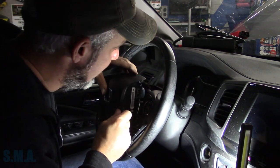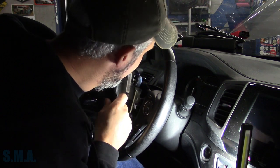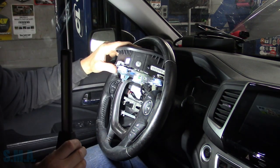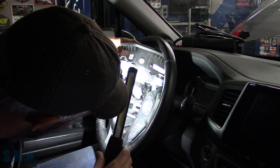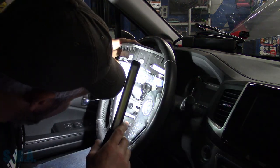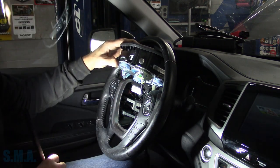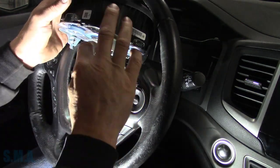It's like you're defusing a bomb. After we take these out, the airbag should slip right out of there. Okay, wheels are straight — close enough. So let's see what we have under here: looks like we have a ground wire because this is our horn switch, and we have two airbag connectors. I wonder if there's anything special about unhooking them — they've got little white tabs. I assume we pull on the white tabs and they'll disconnect. I brought you closer in case it exploded — don't want to miss a good video opportunity.